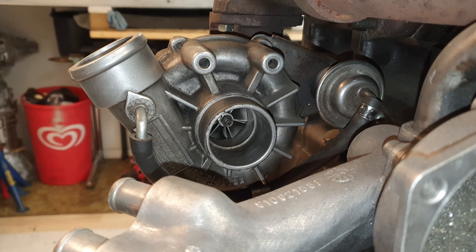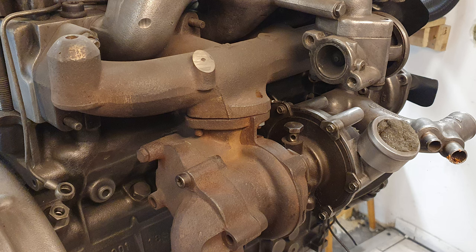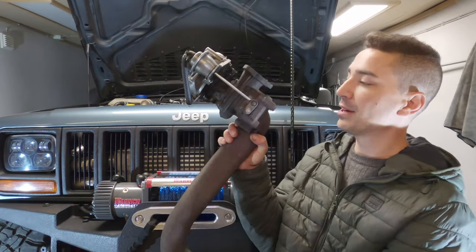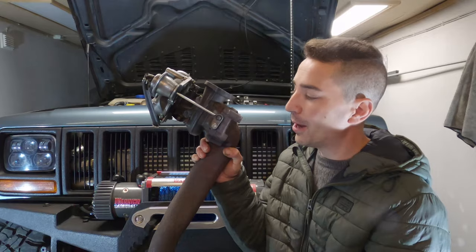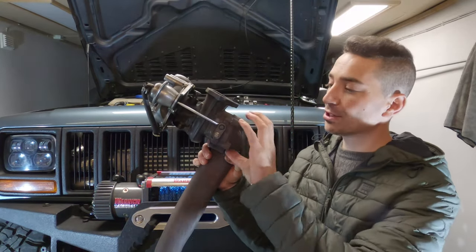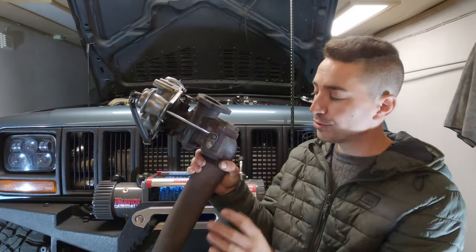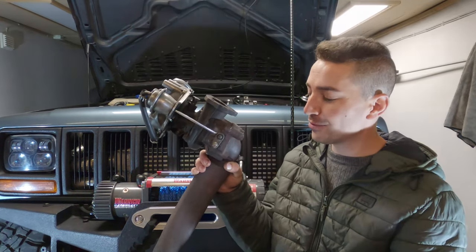This is a really good turbo to strap on that particular engine, because obviously it goes straight on. This is from that engine. You know, you've got the 3-bolt there. It goes directly on the manifold. And if you're lucky and you do get it off of a Mark 1 engine, you get the solid cast one-piece downpipe instead of that horrible downpipe you get on the Mark 2, which is this flange. And then they've just welded on like a 1 mil thick downpipe coming out the back of it.